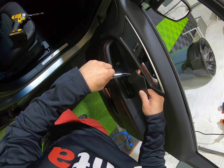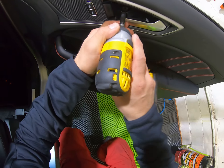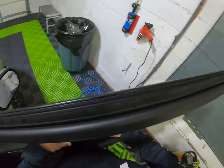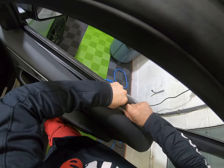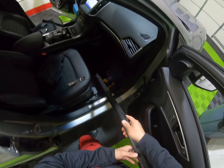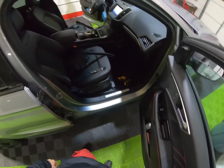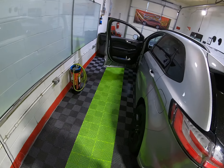It's got these two clips that go right here, so just slowly slide it down and it will come off. The 10 millimeter bolt comes off, then just pull the panel a little bit and it comes off — leave the sweep and it comes right off. You can use your cover to protect your panel, then do your full installation and you're good to go. Alright guys, this is a 2020 Ford Edge sweep removal for the two front windows. You all have a good day — Team Pro!